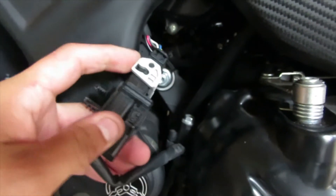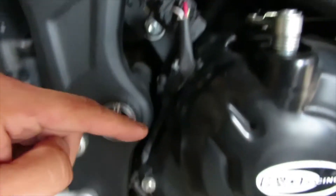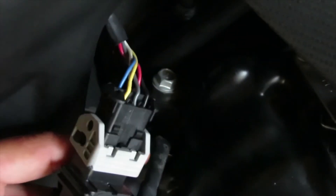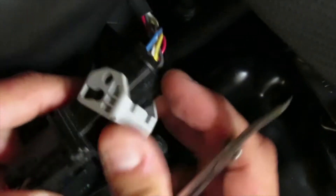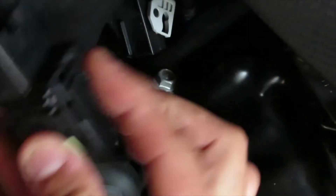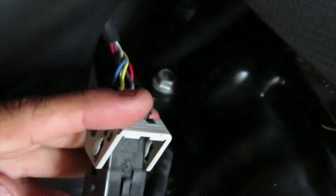What we're going to do right now is disconnect it and then plug it back in and see if that takes care of the problem. If it doesn't, it could be that the O2 sensor is faulty. To remove the plug, you're going to need something flat — typically a screwdriver. Just go ahead and put it under here, pop it up to open the clip, and push it in all the way. Then go ahead and unplug it — as you can see it came off pretty easy. Here's the oxygen sensor, and here's where it connects.